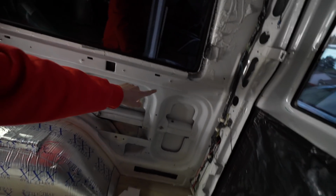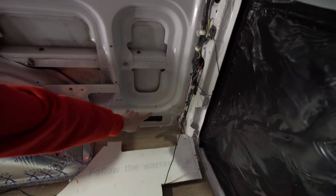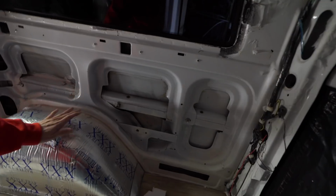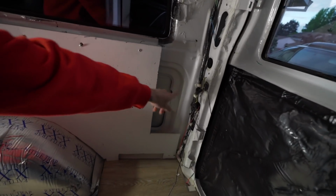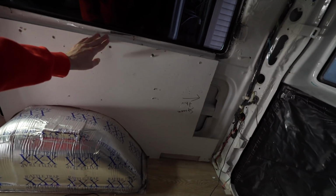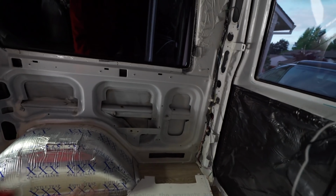And I'm just going around with silicone sealant, which is mold proof for 10 years and on, and went around the whole area and put some in the middle so I could press fit it on and just stuck it on there. And I got so lucky that I had these side panels pre-cut out. Of course, I cut this part out so I could use it for something else before, actually for the floor. It's right down under there. So I already had the outline, and I could just trace and cut it out. That made it much easier for me. And I'll use these in the future when I'm paneling the whole way up. So that was the first step.